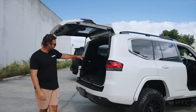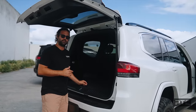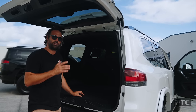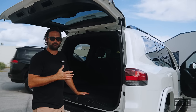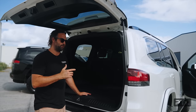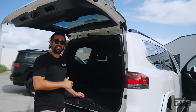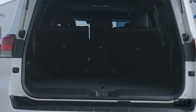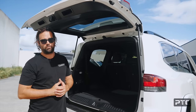While I'm around the back of the VX, the VX is one of the models that does retain seven seats. As part of the 4200 kilo GVM kit, we remove the seats and put a false floor in, but this particular customer has requested that we keep the seats back in. So we have to do the GVM mod, pre-rego, get it all complied, and then we put the seats back in and get that approved under a state approval or blue plate by a local engineer. So this one still does have the seven seats back in under a post-rego approval.